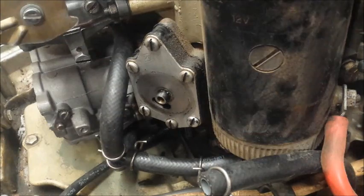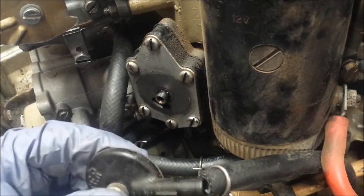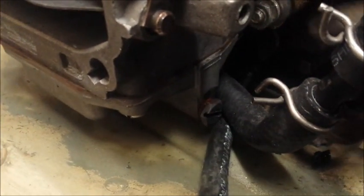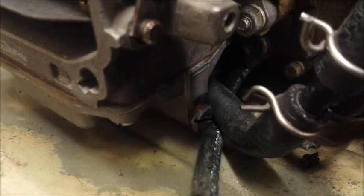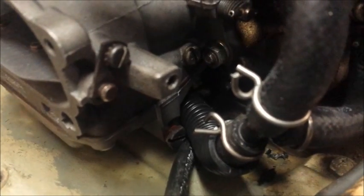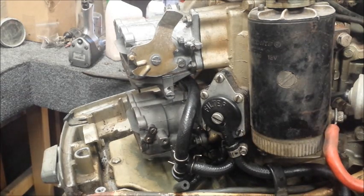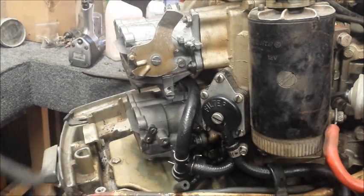The fuel pump surface is good enough for my test start. I'm going to put a new gasket on — first I'll hook this up and then screw that down. Here's something I noticed: is there a fuel line touching that screw? A little too close for comfort there. I don't like the idea of that fuel line rubbing on the side of that screw. So I'll put some expandable tubing over the fuel line — that should give it a little bit of protection. My clamp didn't quite fit over the fuel inlet, so I'll just use the hose clamp. Cleaned up the air cover silencer a little bit so it's not all greasy and disgusting anymore.